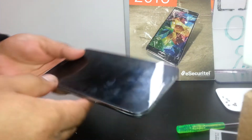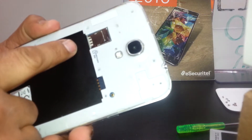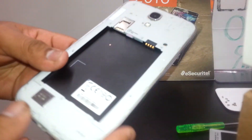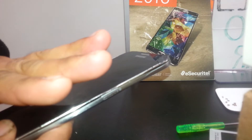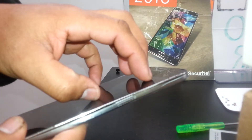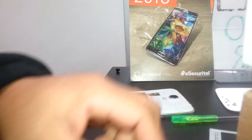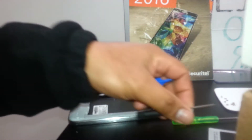Let's disassemble the Samsung Galaxy Mega from T-Mobile. We're going to remove the SIM card and external memory card. We already removed the screws to save some time. The purpose is that the LCD is broken and we're going to need to change the glass — in this case, the whole screen. We'll use the T6 screwdriver and a plastic opener, and you may also need a flat screwdriver.